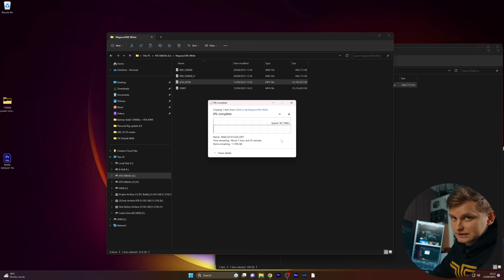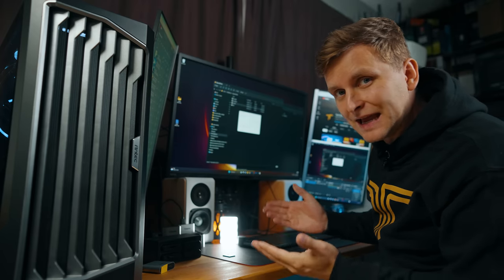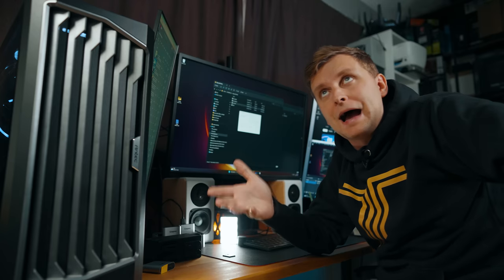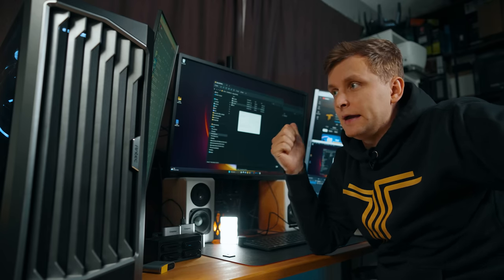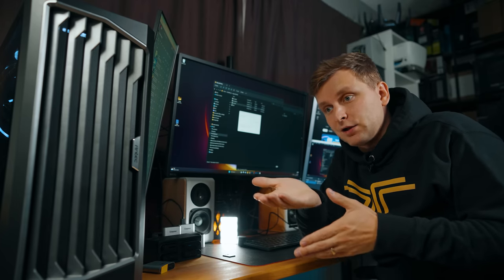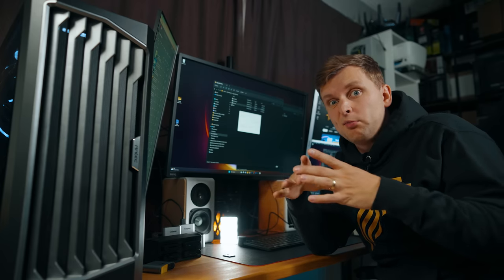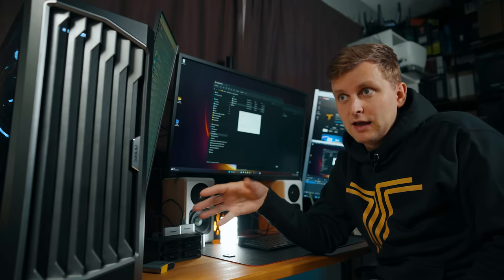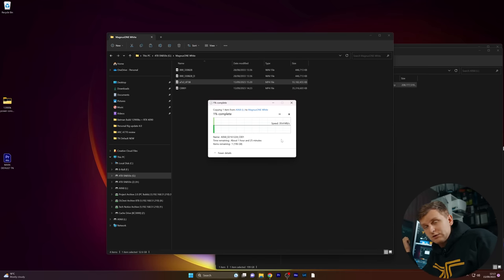And that's why I was hoping to get the card and get the speeds of the card, which you can see, yeah, we're getting about 550 megabytes per second. Still, that's not the full 10 gigabit they advertise on the card. Now, is this to do with my PC layout? Is it latency? I don't think so. Is there some kind of PCIe switching going on? I checked the motherboard. That last slot is a PCIe Gen 4 x4 slot, so four lanes of PCIe. Even if that card is PCIe Gen 3, we're still gonna get plenty of bandwidth for the 10 gigabit speed we'd need.